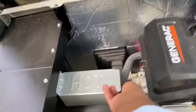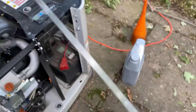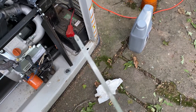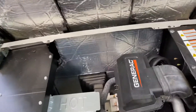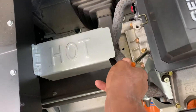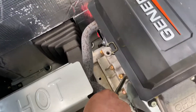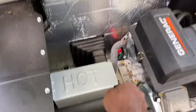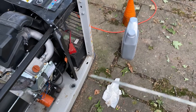What we're going to do is check the oil level. We're going to pull that out — it can be very, very hard and very sticky. Check the oil level between those two dots. This one needs oil. Clean it with a paper towel, put it back in, push it all the way down. Pull it up, and we see that we are low on oil — we're at the lower dot.